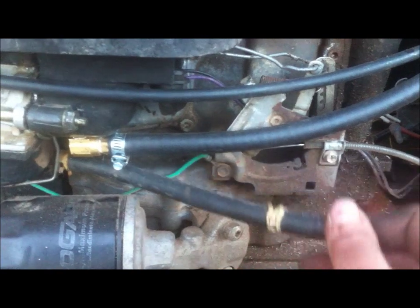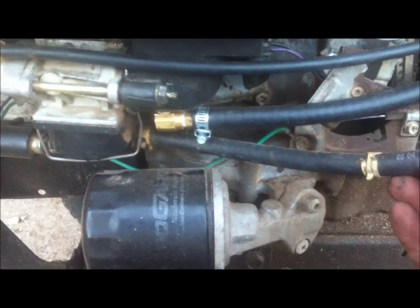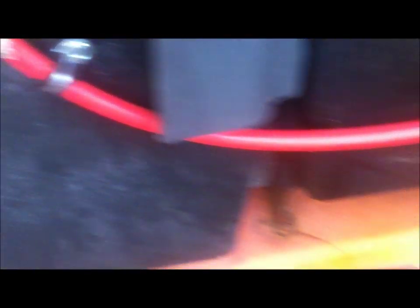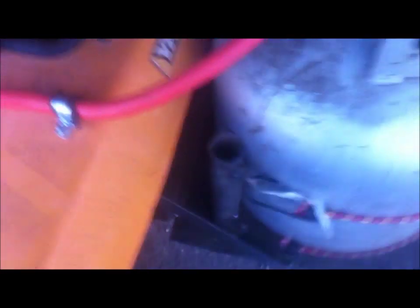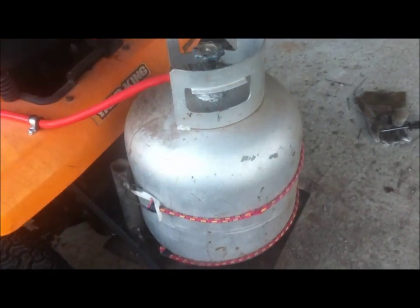Other things I've done is just taken the regular gasoline line and plugged it. Everything for the gasoline is still intact — I could probably just switch it back over to gas, probably have to take that washer out, and cap that off to prevent any vacuum leaks. Up here the regulator is mounted. Here's the high pressure hose with a couple of clamps to hold the hose in place. Back here is my platform with the propane tank — just welded a couple pieces of pipe with some chain links for some bungee cords, so that holds it pretty good in place.